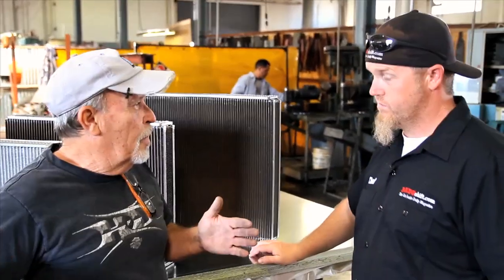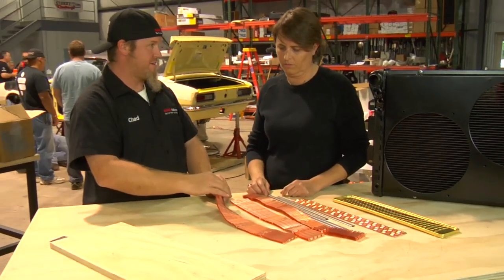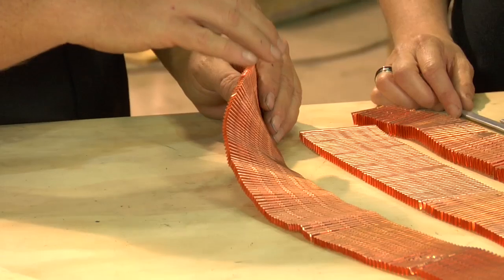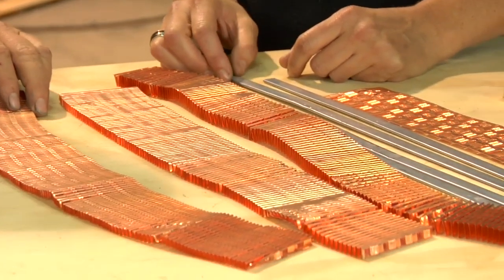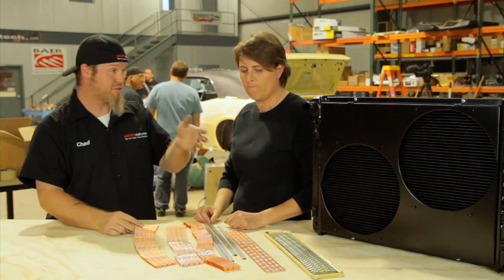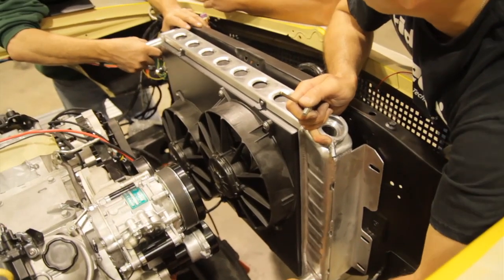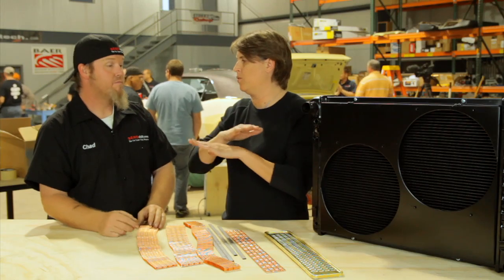Air is different — the more air you flow, the better it gets, no matter what. The five sixteenths fin spacing is the smallest you can get and still promote air flow through the radiator, but you definitely need a good fan behind it. It's a pretty tight core — not a brick, but it still needs a high efficiency fan like the Spal fans we're running. With the Optima, because there are so many tubes with so much coolant going through, we like to try to slow it down by using a triple flow.